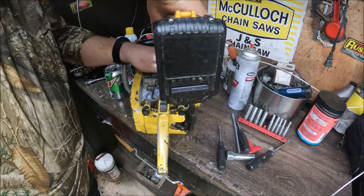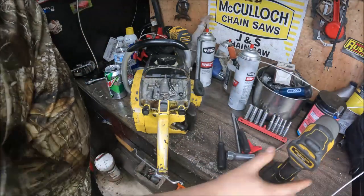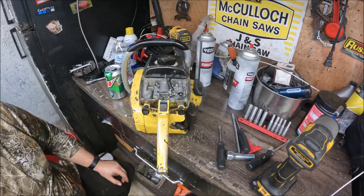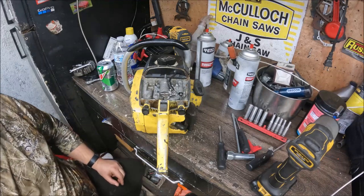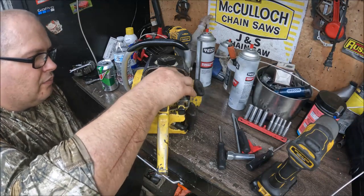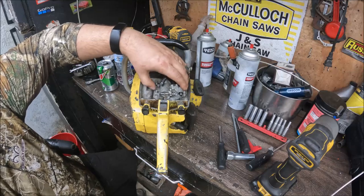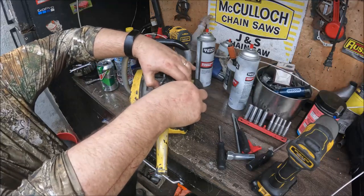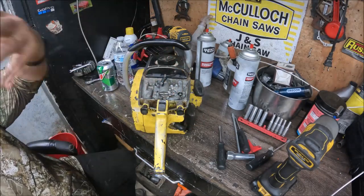When I assessed the saw to see if it was even repairable, compression did check good on it, but I've not had a look at the piston or cylinder. It will fire on a prime. It wasn't when I got it here. It had ignition issues. The points had to be cleaned, filed back, and then after that, I was able to check it out. It would fire and try to run. I will save all of this stuff and send it back with the saw.